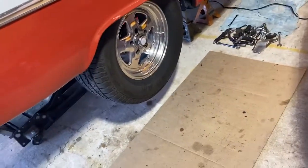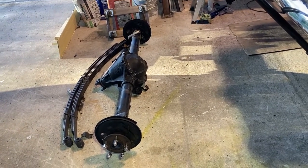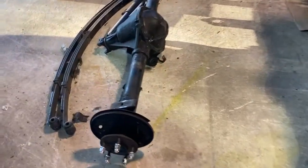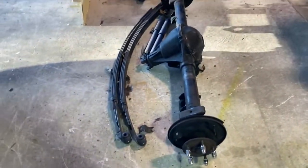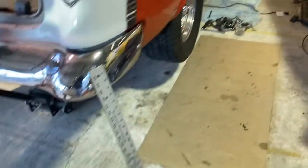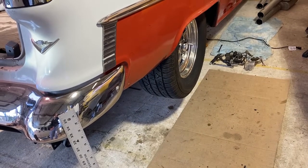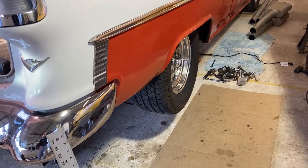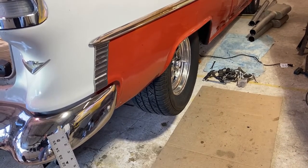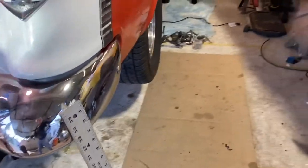Had to get some new lug nuts. This old 12-bolt was 61 and 3/4 inches from the backing plate on both sides — 61 and 3/4. That was with the leaf springs. Well, this new rear end housing is 56 and a quarter. That's from the disc brakes — this was drum brakes, now we're going to disc brakes. And 56 and a quarter with the disc rotor and the hat, where the rim actually bolts up and rests against. So now we've got plenty more clearance.